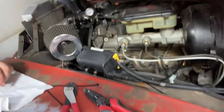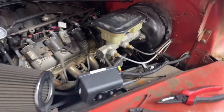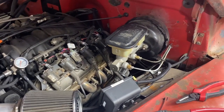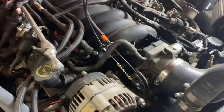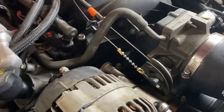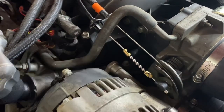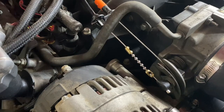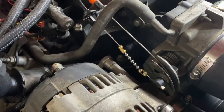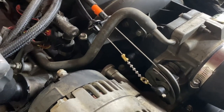The cruise control module servo is mounted with the bracket that's applied, and it just happened to go right in here. I had my own loom that I put on and ran inside the cab already. This particular kit came with an extra switch, which I'll show you in a minute, but I think I can run my stock S10 column just fine without using that switch. This is an LS1 intake. I got this clip that came in the kit — I wanted the little chain links so that it flexes out of the way when you pull full throttle, so you don't have any binding. This comes with the kit and goes right on the LS1 throttle body, so you don't have to manufacture anything else. This took me roughly 20 minutes to install so far with no wiring done yet.